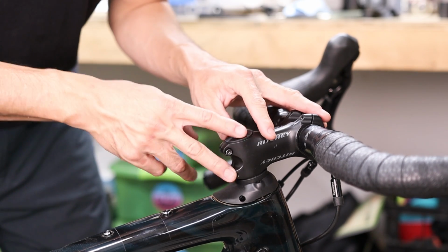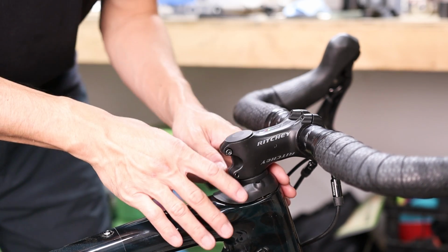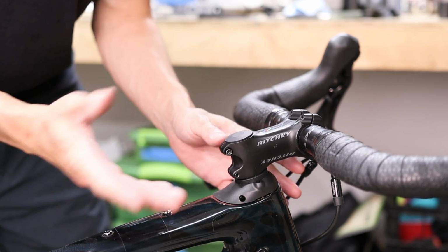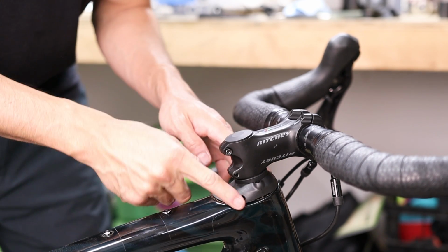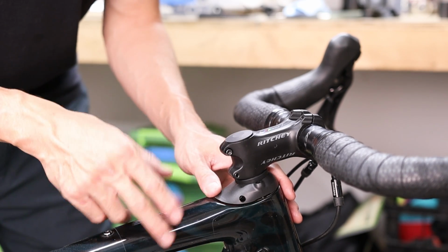Now in this case, even though all we did was remove the FutureShock cartridge and install a Slammer Kit, you still want to make sure to check the headset preload before you head out for your first ride. Now if you're unfamiliar with how to adjust the headset preload on a FutureShock system, you can click the link down in the description for a detailed video.